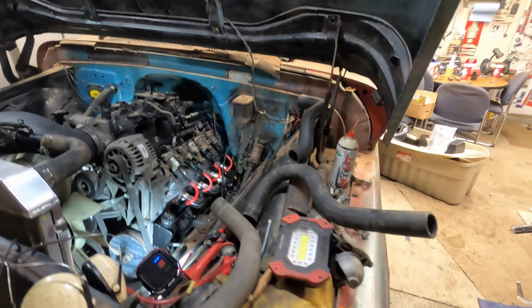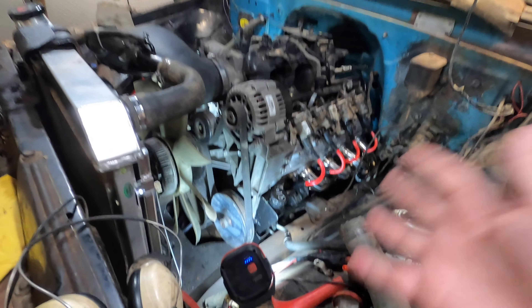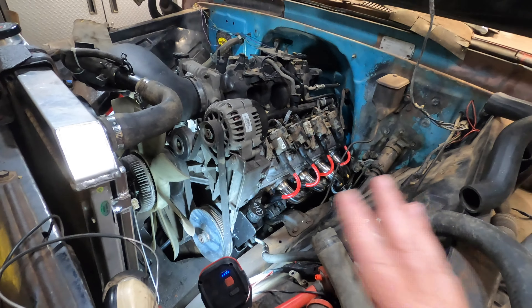I had to extend this — it's just mocked up for now — but the rad is in there pretty good and I don't think it's going anywhere. Rad hoses are covered. I do have to do something with this power steering line since I don't have a pump for it to go to. I might just circle it back to itself, or maybe get rid of it and put an idler pulley down there — I don't have power steering in this truck yet so I don't really need it. When we come back CJ will be here and we'll start feeding the wiring harness through.